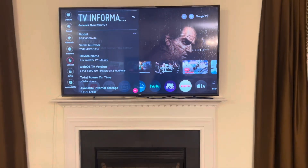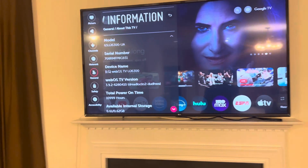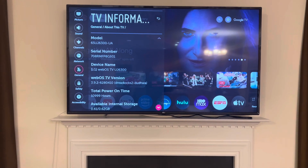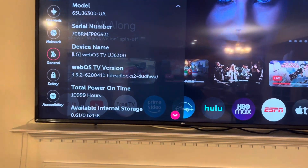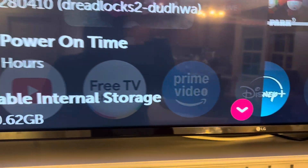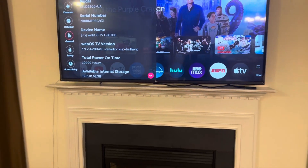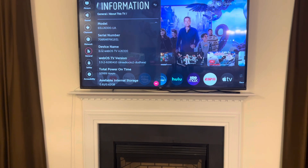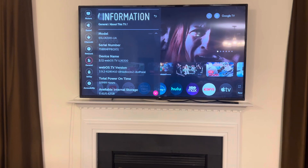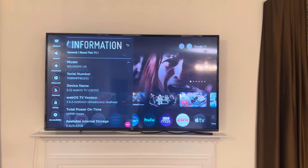The display is perfect — satisfied with this job, it looks fantastic. About $40 for the parts. One thing I forgot to mention: when removing the ribbons on the bottom to disconnect your LCD, be very gentle, because with time and heat you might damage the ribbon and make it a useless repair. Please be very careful, have someone helping you to assist lifting things. That's it — it's fixed; you don't need to buy a new one.